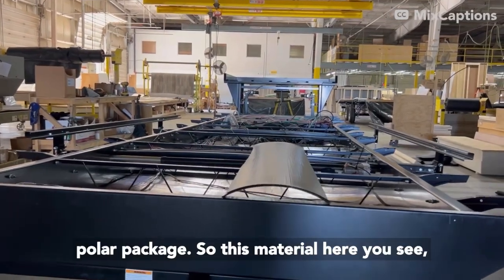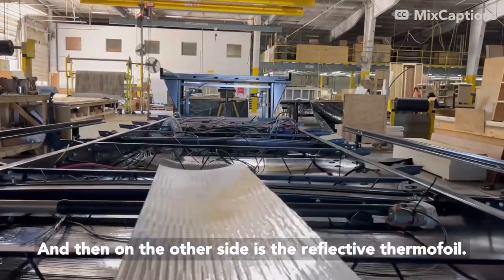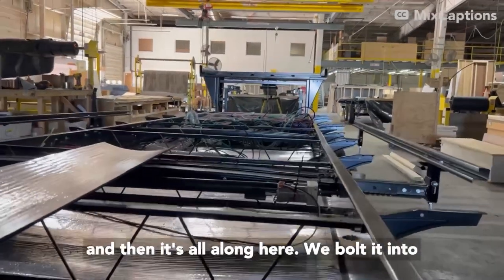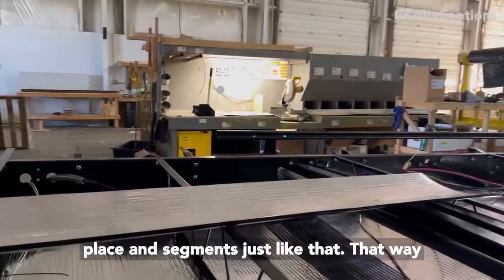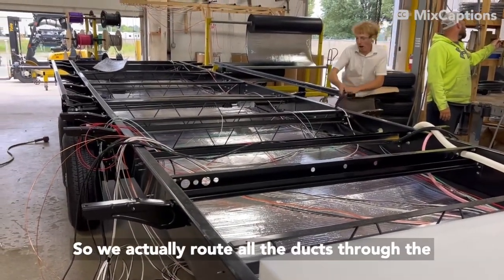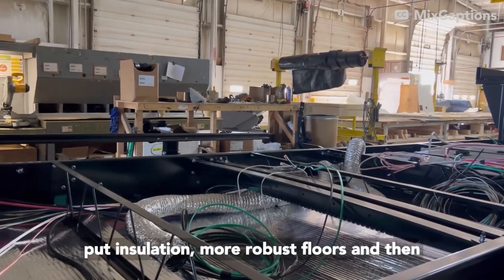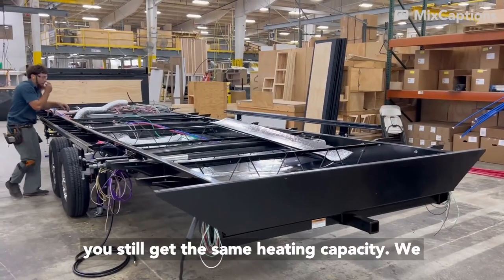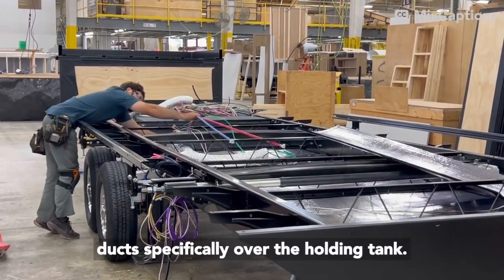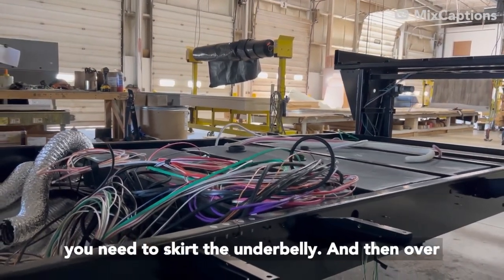This next part of the tour I'm going to show you the polar package. This material here — you see it's the black underbelly — and on the other side is the reflective thermofoil. We actually build it into the underbelly and it's all along here. We bolt it into place in segments, so it's a lot easier for you to service the trailer. As I go along here you'll see those ducts. We actually route all the ducts through the cabinetry in our Sabres. We don't have in-floor vents — that creates more areas where we can put insulation, more robust floors, and you still get the same heating capacity. We take that duct over here near the holding tanks and the guys will mount one of those ducts specifically over the holding tanks. So while your heater is going, there's always air circulating into the underbelly, giving you about a negative six Celsius degree rating before you need to skirt the underbelly.